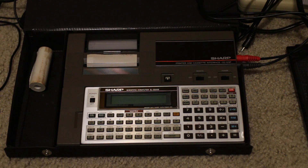It has a 1x24 character LCD display and a Hitachi SC61860 8-bit CMOS CPU running at a blazing fast 768 kHz. It has 72k of ROM, an 11-pin port on the left side with standard 2.54mm spacing. Most remarkably, this will run for years on two CR2032 button cell batteries. Its power consumption is 0.03 watts, which is not a lot.